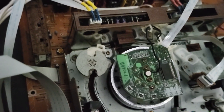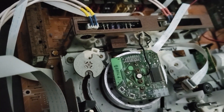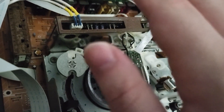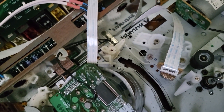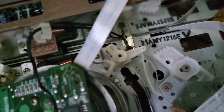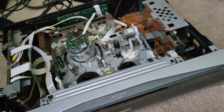I also had a really hard time getting the ribbon cable from the heads to the digital preamp board reattached. No matter how much I put it in, it just wasn't enough — it was literally like a millimeter off. But then one time I managed to do it and I didn't want to mess with it again. Also, these units do have that little head cleaner thing that can deteriorate over time. As you see, I got mine out — there's just a little clip there that you can undo and pull the little thing out. And that's about it.